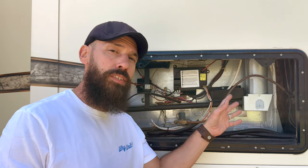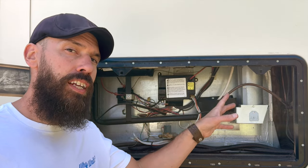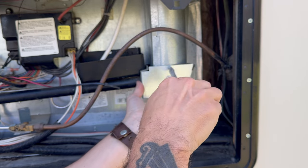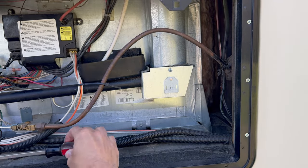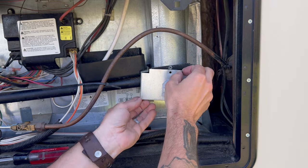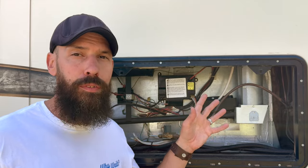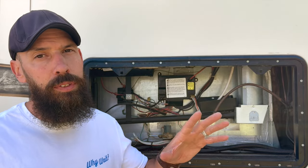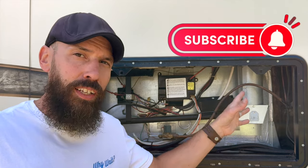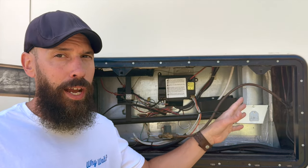If you're not comfortable disassembling things and the flame looks good, just leave it alone. If you do need to take it apart, disengage the housing around the burner assembly to clean a blocked or defective burner. Accumulated buildup over time will hinder the burner's ability to cool the unit efficiently. If you haven't checked this in a few years, it's worth doing.